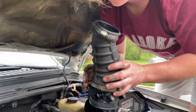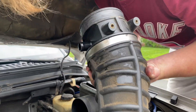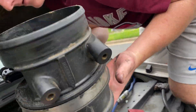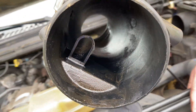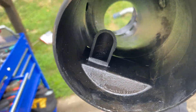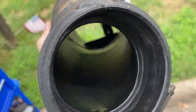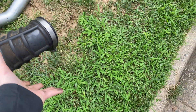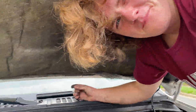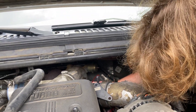There's the turbo. Dude, that's so not good. Let me show this to you — what we're looking at here is mud. It's just oil buildup. So what's the next step? We'll see if this thing has any compression left.